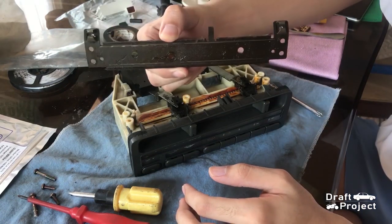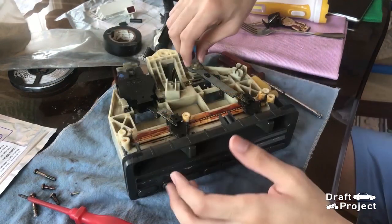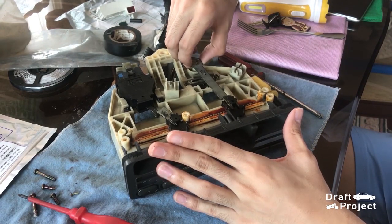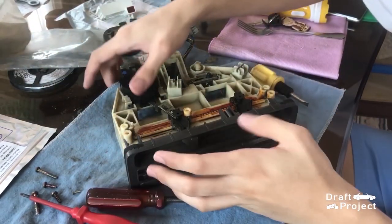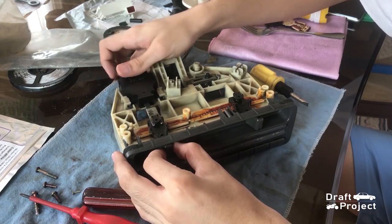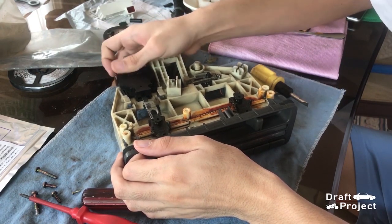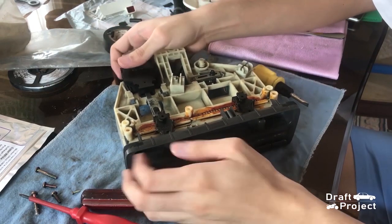Remove the sliding bracket and clean it. I will remove the plastic lock of the thermostat arm — just twist it to unlock, then lift and pull the arm away. Next is the fan selector, which is held by 2 plastic locks. Just grab 2 screwdrivers and push it inward and pull it backward. Now we can remove the face.